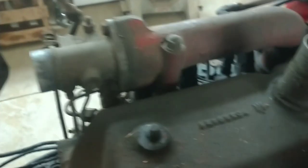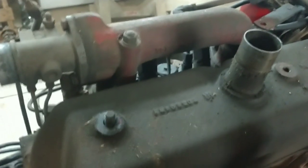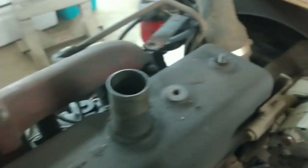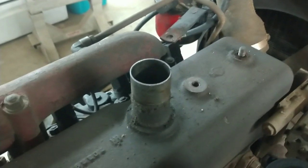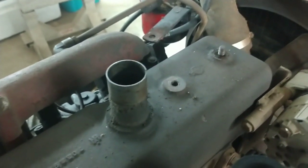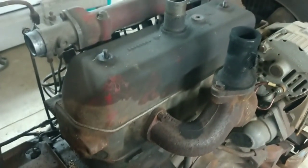At this point we're probably going to go ahead and adjust the valves and do all that stuff you're supposed to do, since I probably have a hundred hours on it and have not re-torqued the head. I'm not super upset it's leaking unless it still leaks afterwards. When I did this engine, I did nothing to the head — the head was fine, I cleaned it and put it back on. So it didn't have a brand new mating surface anyway.